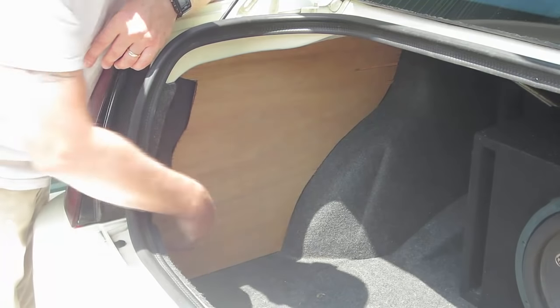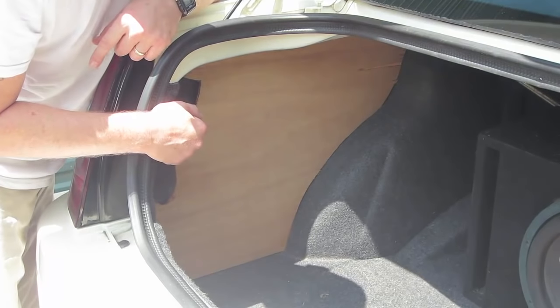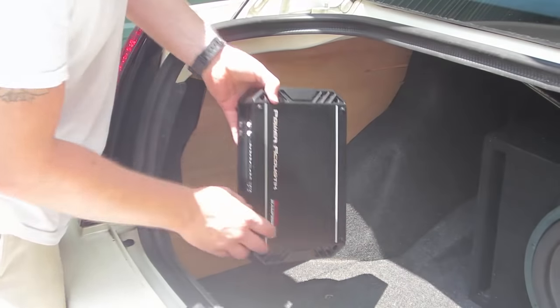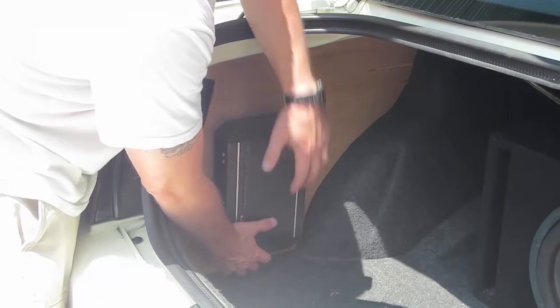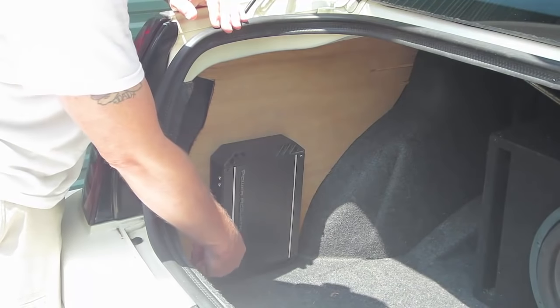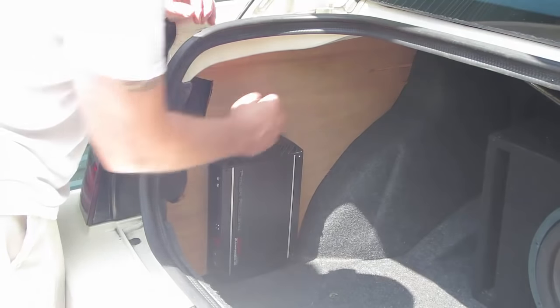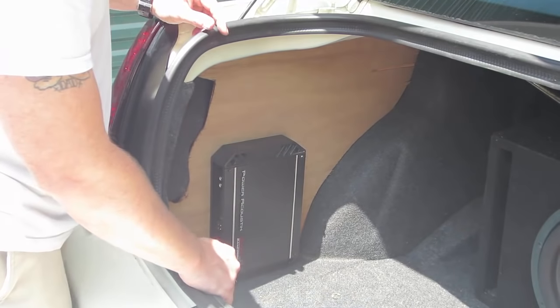Down here my plan is I'm going to take my amp and mount it right up in here. I'm going to have about an inch or so — maybe three quarters of an inch — so I'm going to leave it up and I'll have it standing vertically with my wiring facing the rear of the vehicle so I can run it around to where I need to get it, and let it sit flush. I'm going to show you how I do the back end construction portion of the amp. All my wiring is going to be shooting over to the rear side. I don't want it sitting on the ground — I want it to be up a little bit. So I've got some lumber inside I'm going to use to bring this up just a bit, let this rest on it, trace out the exact amplifier dimensions, move it back with the jigsaw, cut that out plus a little bit to make room for the material that I'm going to wrap around there with the glue, carpet, and trunk liner, mount it up in there, fix it with some hardware, and this thing should be all set to go.